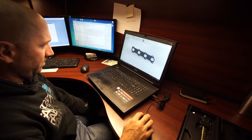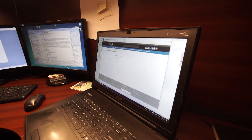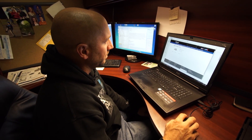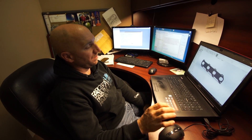Speaking of imagination, you picked out a lot of parts for my car already, and I know you used the website earlier. Yeah, so we're gonna use some UJ bends, some collectors, some spring tab kits to hold those collectors together. Now I gotta ask — how do you know what you're ordering, how did you figure out the sizing? Well, I measured the exhaust port shape and I want tubing that's gonna match closely to that size — that comes out to about an inch and a half. If I take some inch-and-a-half stainless tubing, I should be able to squeeze it into the shape of that port and weld it from the inside. So our primary is an inch and a half, and our secondary is probably an inch and three-quarter.